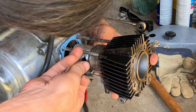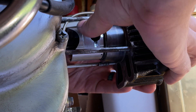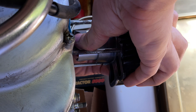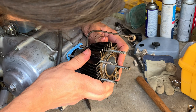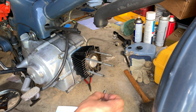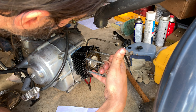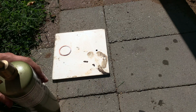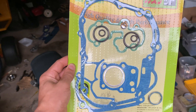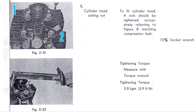I'm making sure the connecting rod doesn't push backwards into the engine. Getting it over the first ring is the easiest; I do the same thing with the second, making sure everything doesn't push back and cause my top rings to pop out. Once it's all the way in there, the worst is over. The push rod rings are going to want to fall out, so use some grease or Vaseline to hold them in. I'm reusing my copper cylinder head gasket ring — blasting it with heat for at least a minute so it expands back to how it should be. Tighten the nuts in an X pattern at 5.9 foot-pounds.